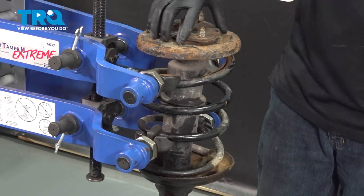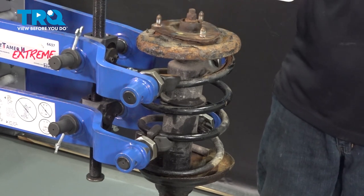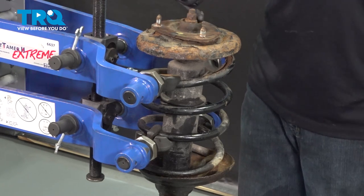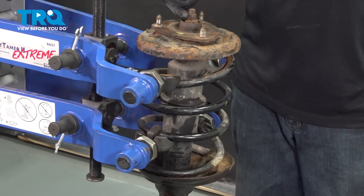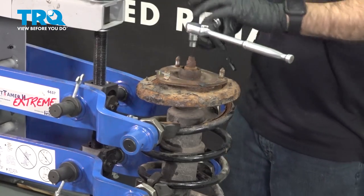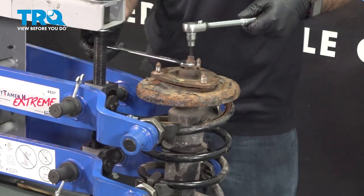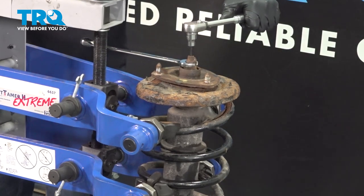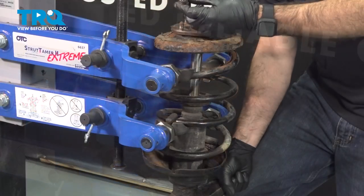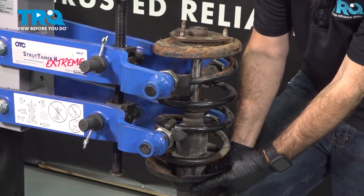What we're trying to do here is loosen this just enough so that our top plate is free. We're going to undo the nut at the top — we'll put a 9mm Allen in the top to hold the center section and then a 17mm wrench to take our nut off. With that top nut removed, we can set it aside and drop out the cartridge out the bottom.